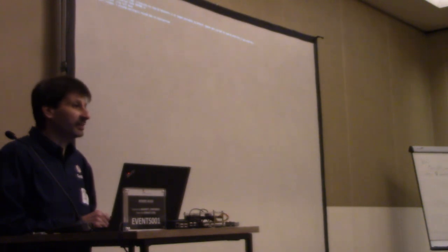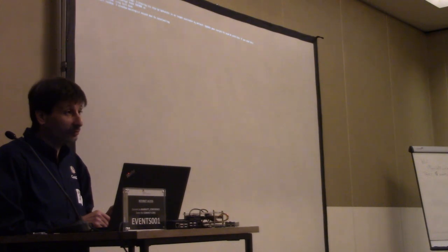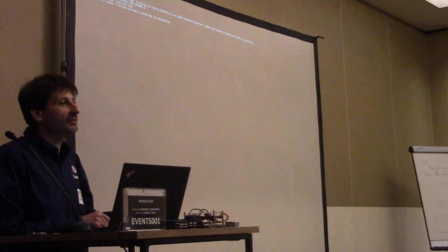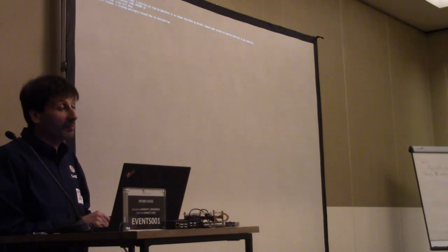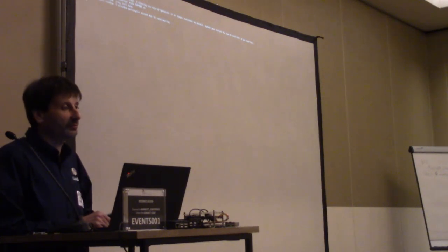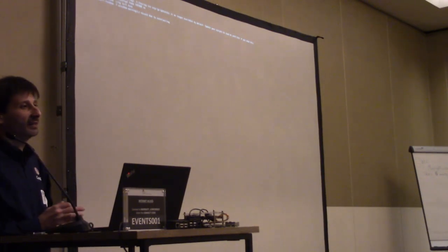So having native SATA, you just stick U-Boot in the SD card, because normally those devices require at least one SD card to boot, because that's the only way they know how to boot. And then you offload the whole operating system to the SATA disk. Or if you're lucky enough and your device has eMMC, you could copy U-Boot to the eMMC and actually boot from there to the hard disk and continue from there. In that case, you shouldn't need an SD card.